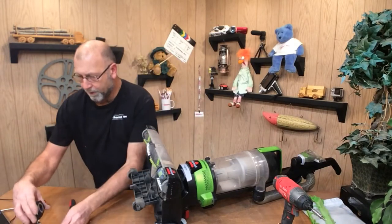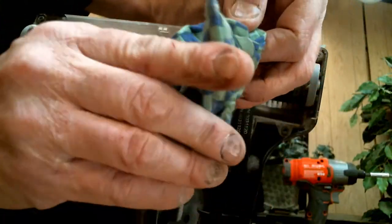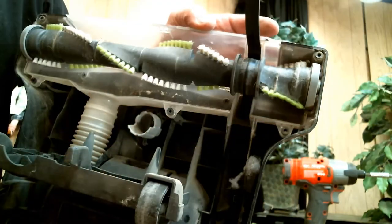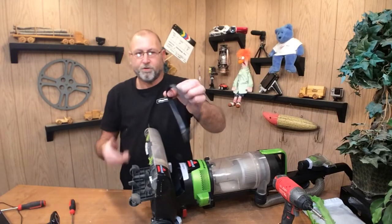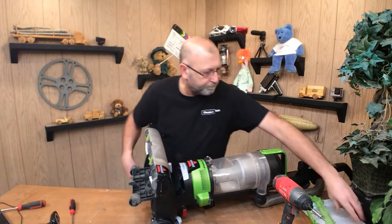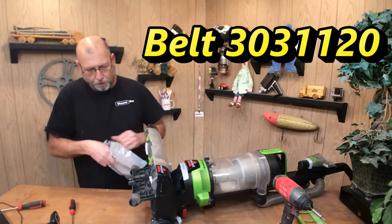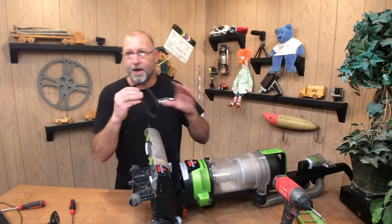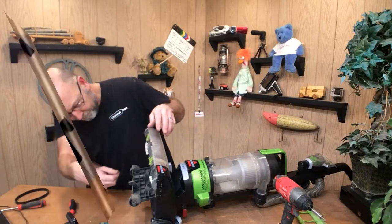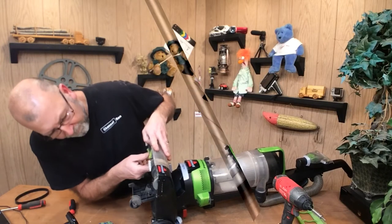Alright, and already we can see why we had a problem — we've got a hacky sack or some sort of toy that was jammed up inside there, and obviously the belt is broken, just like most of them that I pick up on the side of the road. This is the number one problem. I have belts I picked up in the past; if I buy just one I'd buy a couple of them. We have the new belt here, but before we put that on I'm going to go ahead and vacuum out some of this garbage. It was actually quite clean.